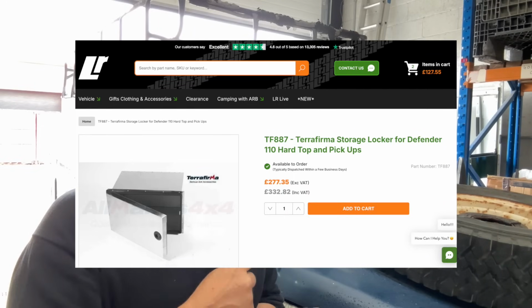Now, we are contemplating what to do with the rear tub. I had an idea that possibly I could fit a side locker to cover up that damage, because that obviously has to be removed anyway. It would just mean a bit of body repair work on the curve of the body, and that is a lot cheaper than repairing or replacing the whole tub. And I've also got a repair capping section for that corner, so we'll still be lifting the roof off.